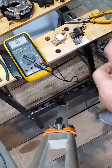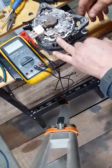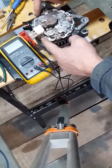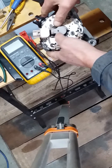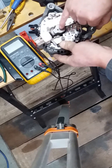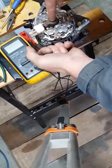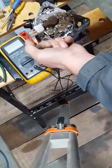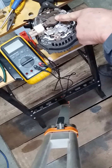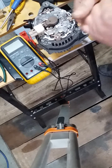We'll get these fitted in place and see how we go. We've got the unit assembled - we've soldered the six contacts and the securing screws are back in place, both for the brush assembly and the voltage regulator. To replace the brush assembly with it removed, stick your little finger inside and push the brushes back, then lower something - either a piece of wire or a sewing needle upside down - insert it to hold the brushes back, slot it into place, and then just withdraw the object. It fits and goes back on nicely, otherwise you'll struggle - it'll be a right pain.